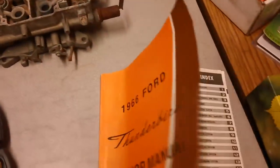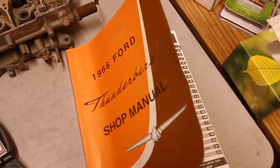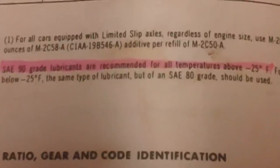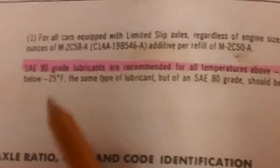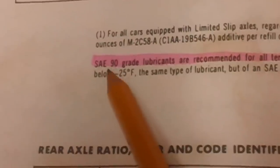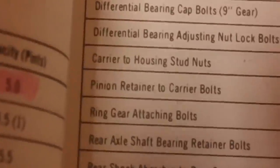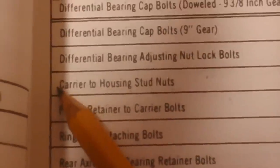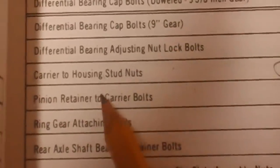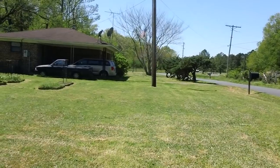And you shall see - I've got a lot of highlighted pink stuff everywhere. It says lubricants, ring gear size nine inch, which is what we have, and capacity in pints: five. Piece of cake - that's why it's important to have one of these manuals. You just can't get along without one if you've never torn a 1966 Ford apart. The specifications also say to use 90-grade lubricant oil, which is exactly what I'm doing - 80W90. And the stud nuts that hold the carrier to the housing: tighten those down 30 to 40 foot-pounds. It's all in the specification sheet.